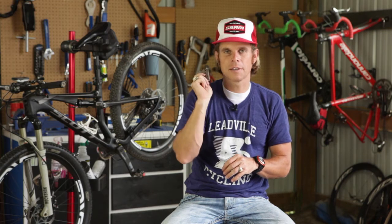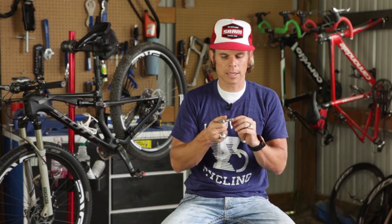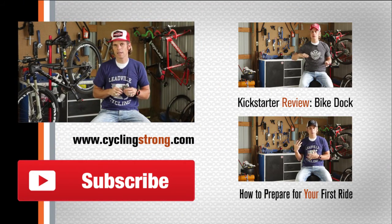I think they did a great job, and I wanted to give them a big thank you for creating this tool because it saved my Leadville race all in one little tool. I got my chain fixed, got to the next station, and got a brand new chain on it. So that's one little tip: if you're out there, make sure you've practiced fixing a chain. Get an old chain, take that link out, put it back in — that kind of stuff — so that if anything like that happens to you, your race isn't over.